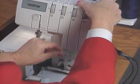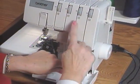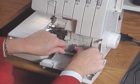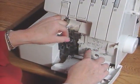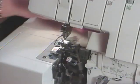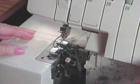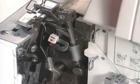Now we're going down through the lay-in threading channel, guiding the thread down towards the green dot above the first hook, continuing to the left beneath the wide hook with a green dot, and then straight up to the third hook. Now you are ready to thread through the eye of the upper looper. Pull the thread straight back towards the rear of your machine and turn your hand wheel towards you to align the looper thread.